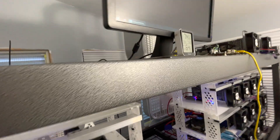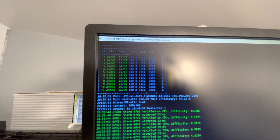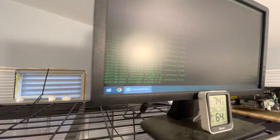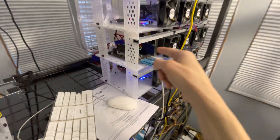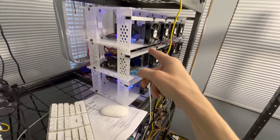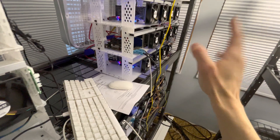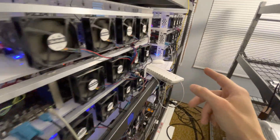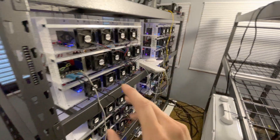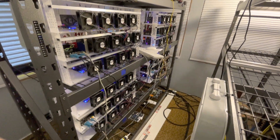This one's actually being tuned right now — the memory frequencies are a little low because I've been having cabling issues with these breakouts. A lot of issues with these: I got a set that were great, then another set with problems and problems. I've been tuning with memory frequency a little low to ensure stability, and I can swap the cables out as GPUs start getting errors so I can weed those out.